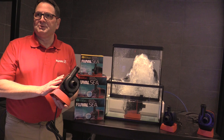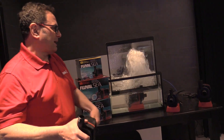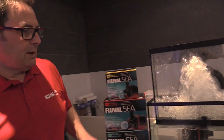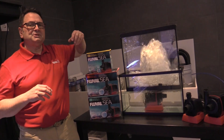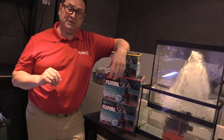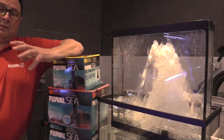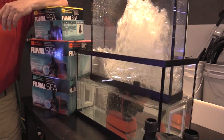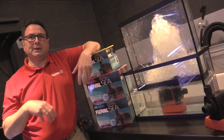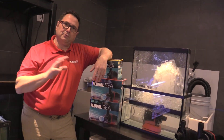This is a well put together pump designed for the right application. Now when it comes to maintaining the lifespan of these pumps, there are some things you've got to do on a regular basis — three or four times a year is highly recommended. Take the pump out of its installation, put it in a one part vinegar to four parts water solution, run the pump submerged in that for an hour or so, let all of the deposits dissolve, then rinse it well with fresh water and reinstall.